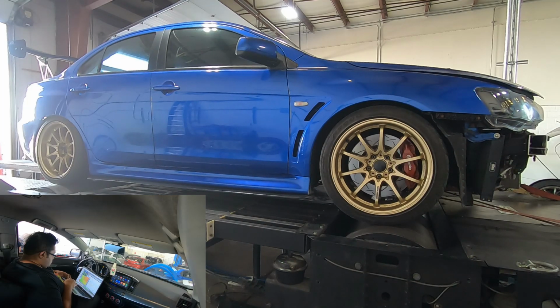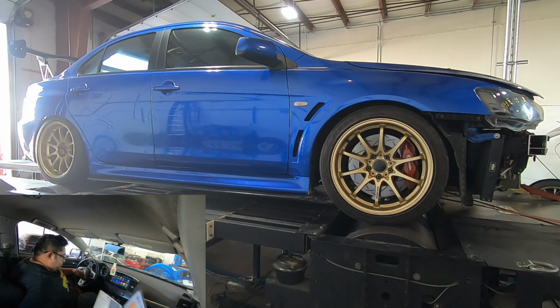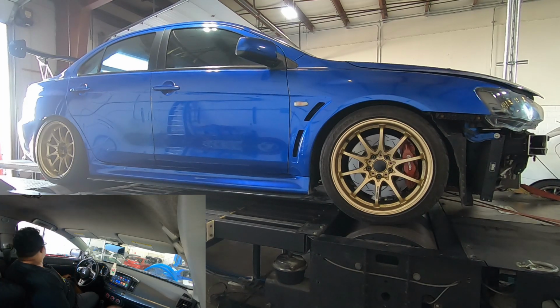One of my favorite things about ECU Master is the logging system. It is really robust, and the sampling rate is pretty high. The way the whole setup is structured really agrees with the way I think, so I love using that. The ECU Master Black also has the ability to use both 4.2 or 4.9 Bosch wideband. And everything on this ECU is closed loop, which is a plus for anyone looking to learn how to tune or at the beginning stages of getting into it.